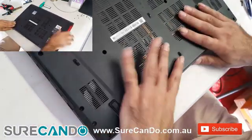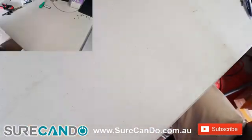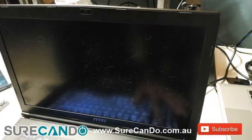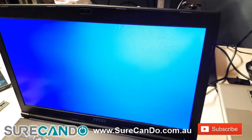And don't put any screws yet. Do a test to see if it's detected in the BIOS first, otherwise you'll have to disassemble again. Now I've inserted my Windows 10 USB and I'm pressing the delete key to get into BIOS to change the boot order to boot from the USB.